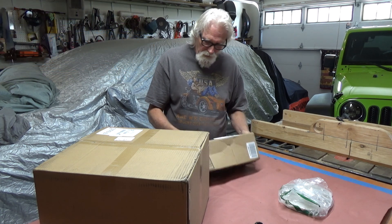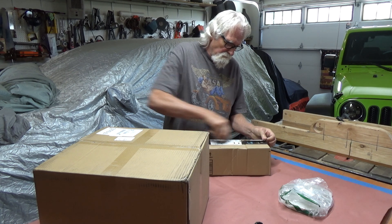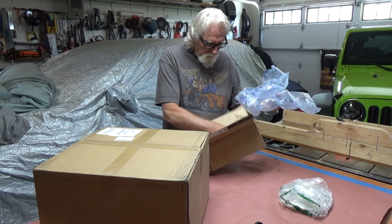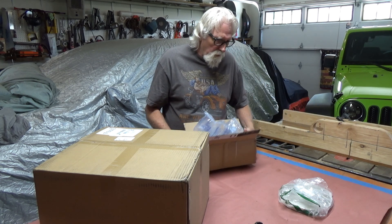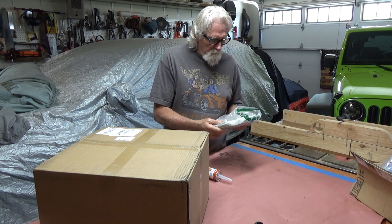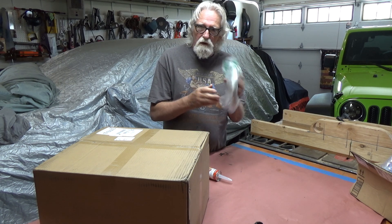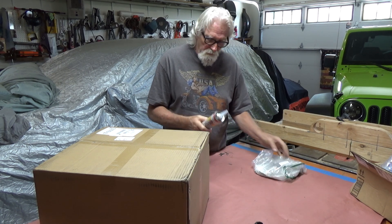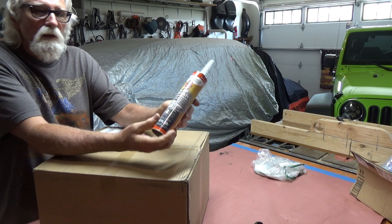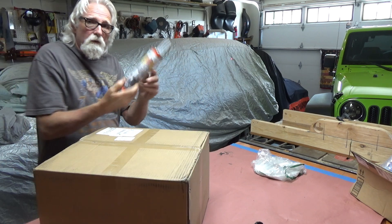Got another shipment in here. As usual, it's from Amazon. This is a banged-up package. The other day we got the Butyl tape — B-U-T-Y-L. I'll show you where this goes — it's going to be a vent. And we got this stuff here, it's called the Lap Seal. It's self-leveling, it's great for RVs. When I'm doing any roof work, this is what I use. I'll show you how that works later.